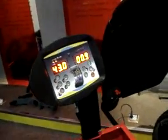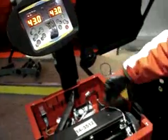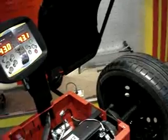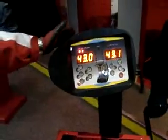Okay, so now you see that one is very active. When I press the wheel, it can fluctuate and change the values, but this side represents the pickup A, it's freezing, no change. You see? So this is strange. So what we need to do first, we must make sure and check the pickup sensor, because inside is a little bit dark, but you can check that the pickup sensors are installed there. Alright, okay, and then we have to go back and check the back of the computer board, look at this eye please.